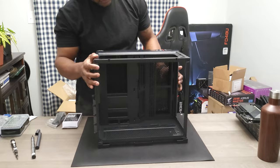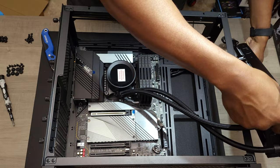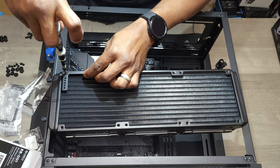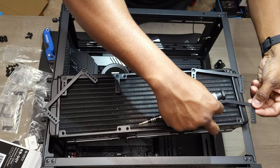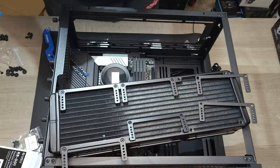This specific case is meant for EATX, ATX, MATX, and ITX motherboards, and since we're going with an ATX board, we have to install this extension bracket that allows me to install just that. Truth, you can fit a 360mm rad into the Lian Li O11D Mini with an ATX board if you offset the rad with these brackets by Lian Li. I know what you're thinking. Where can I find them? Well, you can find them at the Lian Li store on AliExpress, and I have the link below.